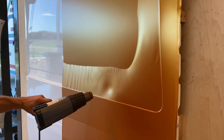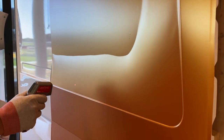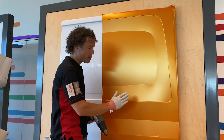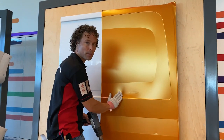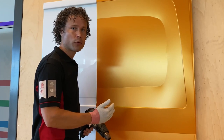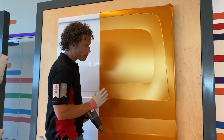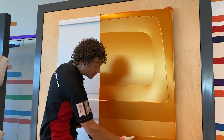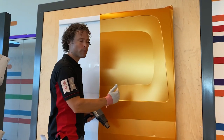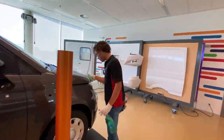You can actually see it as well. If you warm up the film, wrinkles appear. If you then warm it up a little bit further, the wrinkles disappear again. At that moment the film reaches this temperature. When the film has cooled down you can feel that there is less tension in the material. Of course if you are going to apply the film into the corrugations you will have to warm it up again to the right temperature. I always first take away the tension on all areas of the entire panel and then start to work it into deeper parts. So work step by step.